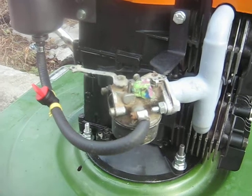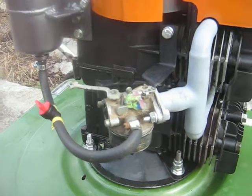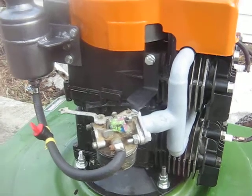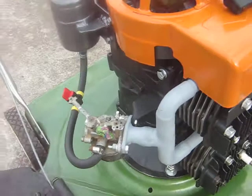The carburetor's not looking too good. That's off a 7-horse Tecumseh. It had an 8-horse on it to start with, but it turns out the main problem I had was an ignition problem — it wasn't carburetion. As soon as I solved the ignition, it started on the first pull.